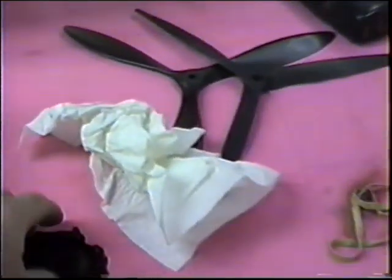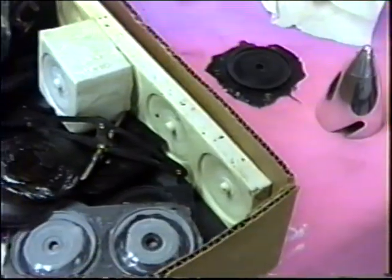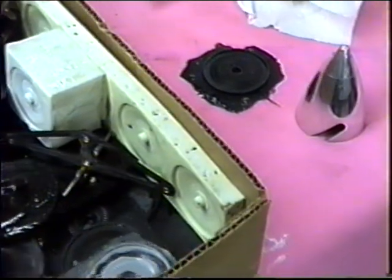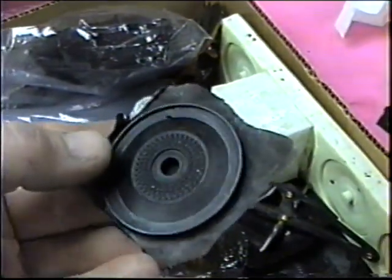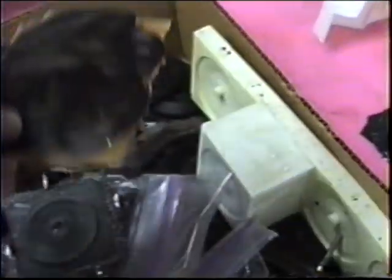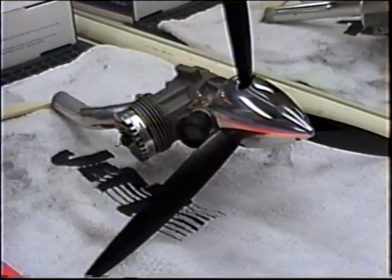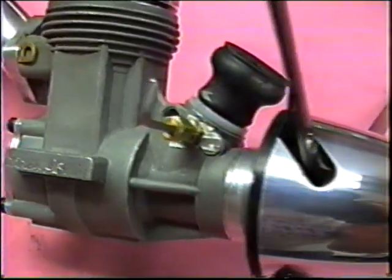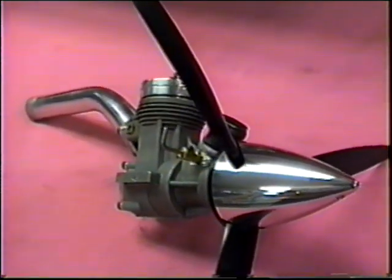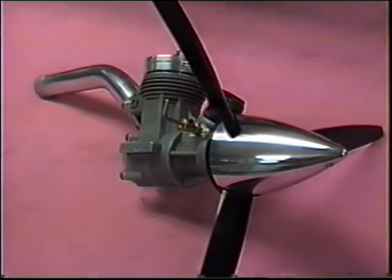Another option here is, and I'll make up a couple spares, these carbon fiber back plates, which will be good as trim features. They're all the same, it doesn't really matter. I had made some at one time with cloth, I had made some with tow. I've got all different variations of this. As a trim feature, that knocks a lot of weight out. Those carbon fiber back plates save quite a bit of weight. Every time I balance one of these up, I'm impressed. Worked well. Used it all last year on this I-beam Spitfire. Hope it's going to work on this guy as a trim feature.